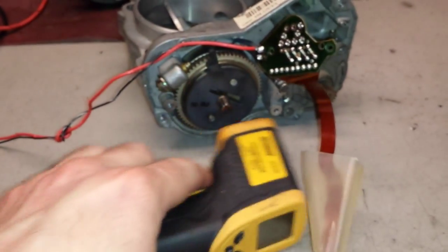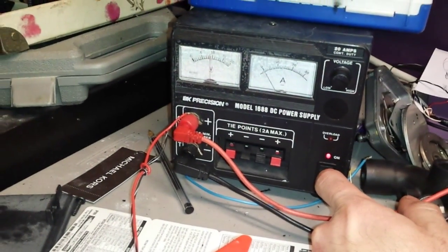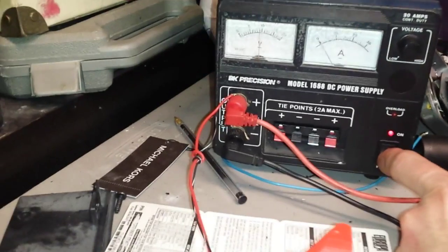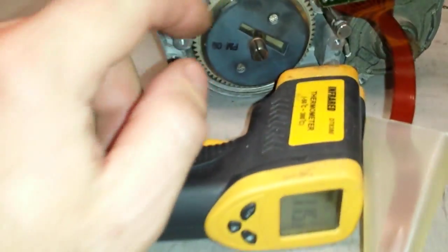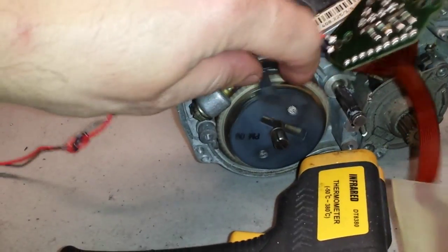Next thing I'm going to do is shut the coil down. It's energized right now at 9 volts. That's what the computer gives out. You can see it's about 9 volts, left dial. I shut it down, so when I shut it down, I can move these two things apart.